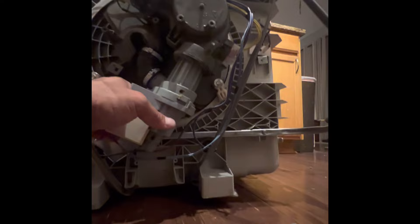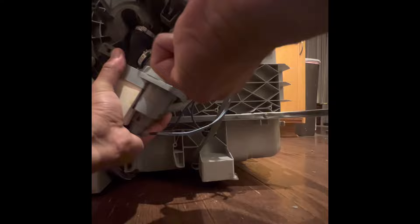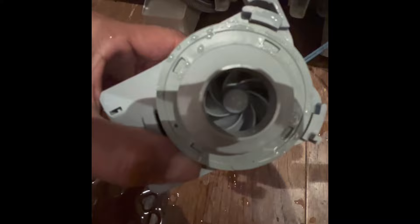The dishwasher is now laying on its back. This is where your problem is right here — still dripping a little water. If it's not spraying, this is your problem. You see this clip here — turn it clockwise. You're going to push this forward here and then turn it just like that. Build some more water out — your problem is right in here.